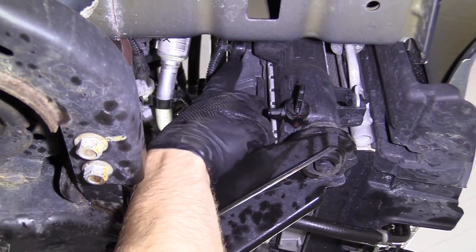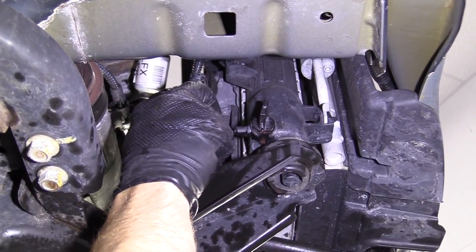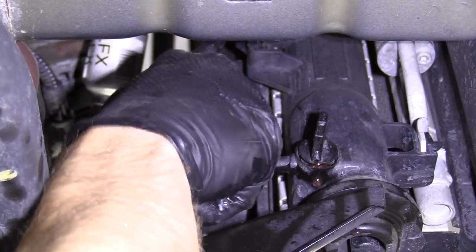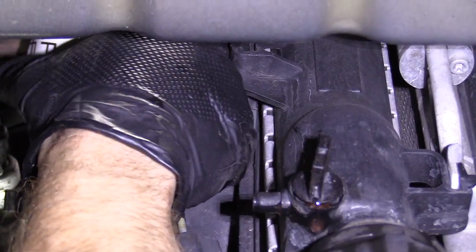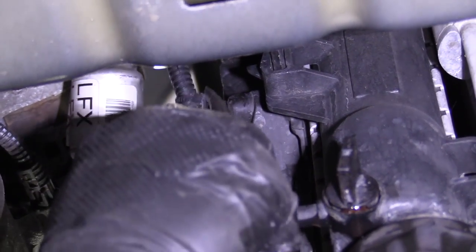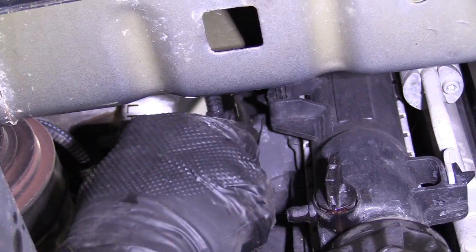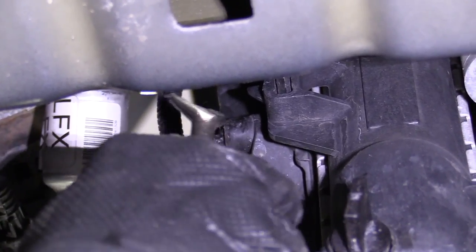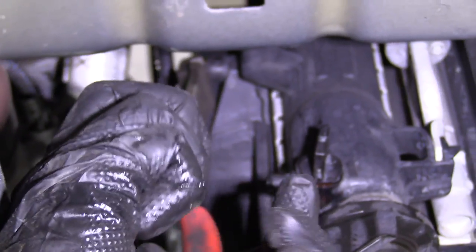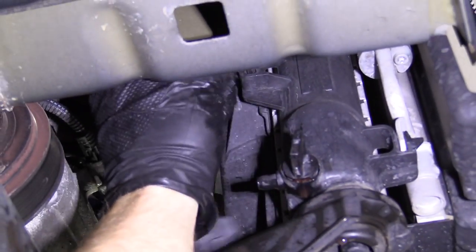Perfect. I'm gonna go ahead and take out this little clip right here. Use something like a little forky tool if you have one. Just try to pull it out of the shroud. They got like all these little teeth on them. Really grip in. Everything's harder on camera, I tell ya. Okay. Well, I'm gonna grab my cutters and grab onto it. Try not to cut it, but just grab onto it and then try to pry it. That'll be helpful. Like I said, I'm gonna be careful not to cut it. All I wanna do is grab it and just give it enough to pry and twist. There we are. Still reusable.